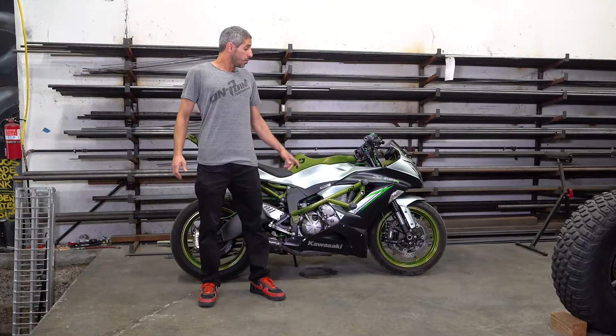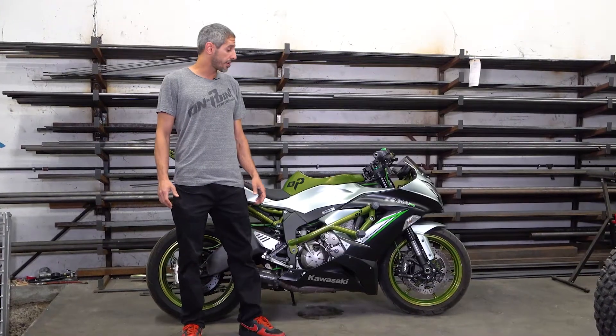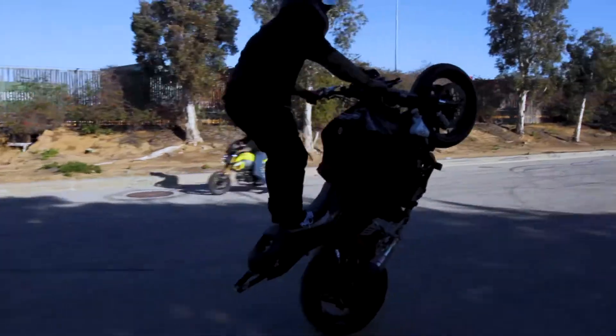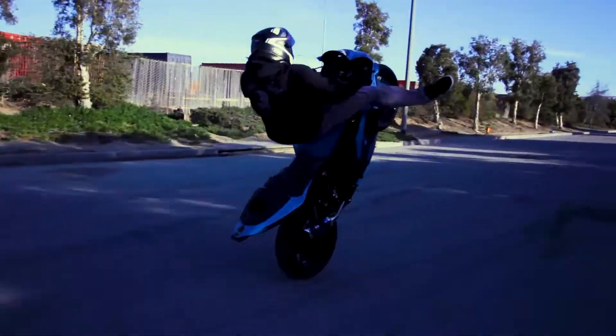For our sliders we utilize a composite material that's strong enough to take repeated hard impacts without exploding, while our competitors use Delrin which has a tendency to explode on hard hits. Slider locations vary on every bike because every bike has different geometry and different mounting points, and therefore the cages have to be designed specifically for that application.